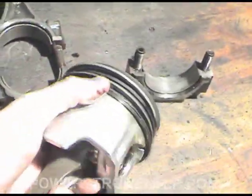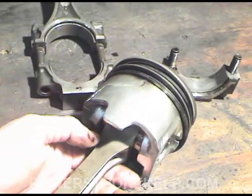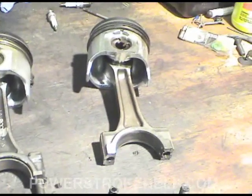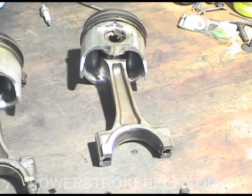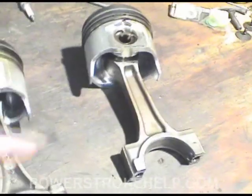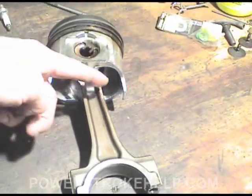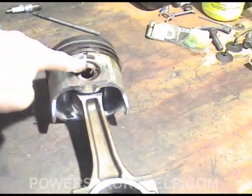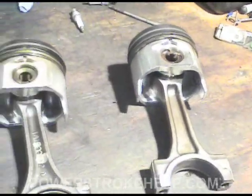Just like this piston is on its way to failing — there's a huge crack in the side of the piston here. That's from high RPM. This particular powdered metal rod and piston came out of a 425 horsepower engine. RPM is usually what kills the connecting rods and the pistons. It'll actually break up in here from pulling the piston back on the downstroke, and it usually will rip the piston before it breaks the connecting rod.